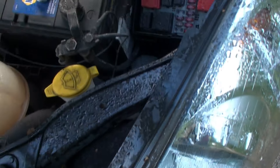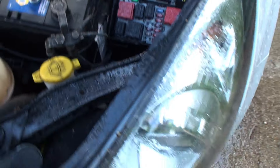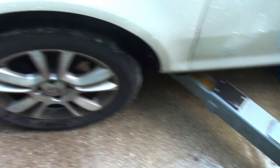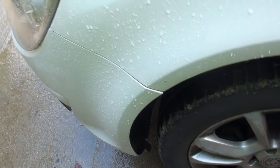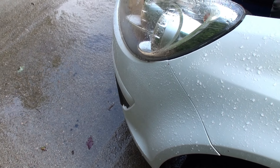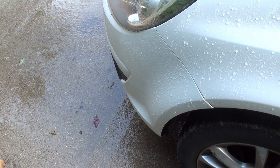I'm going to put that bolt back in by hand rather than trying to feed it down, because the washer won't go through the hole anyway - so again the manual is wrong. Even after removing those, the headlamp still won't come out because there are bolts underneath as well. To access those we need to get to the inside of the inner wing. I've got a ramp here at home so I'll raise it up to film what's underneath.